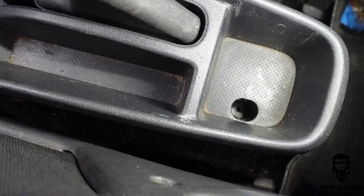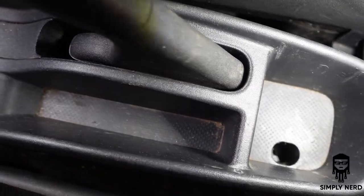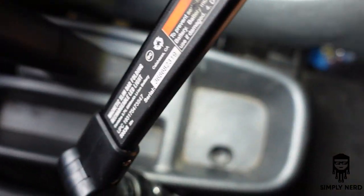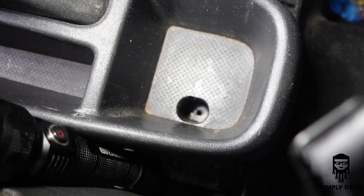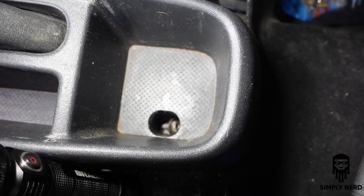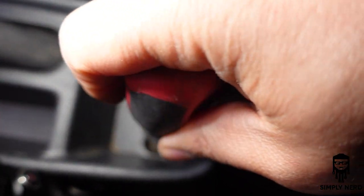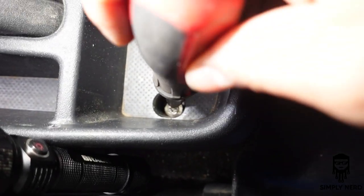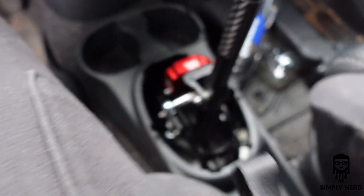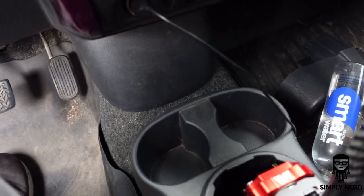And what I like to do is just drop the screw into place. So right there, drop screw into place like that, take the screwdriver and wiggle it up and down. I know it's hard to see on camera, so see it in place, just screw that bad boy down. The front side, I like it tight, so you don't break these, because these are very strong but apparently very brittle as well.